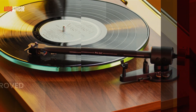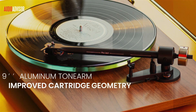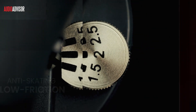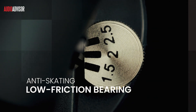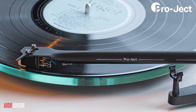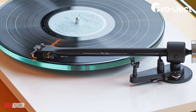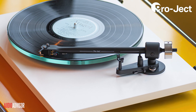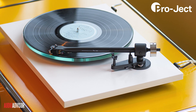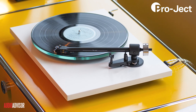The T2 features a 9-inch aluminum tonearm with improved cartridge geometry. It includes an updated low-friction bearing and user-friendly spring-based anti-skating for fast, accurate setup. Notice the head shell — it's built into the end of the arm to minimize arm tube resonance, which is a key factor in sound quality. The more non-resonant your arm, the better your LPs will sound.